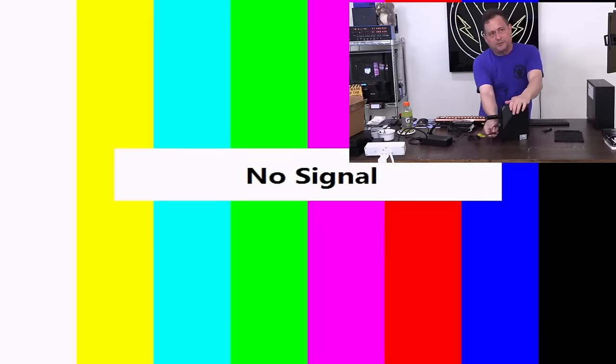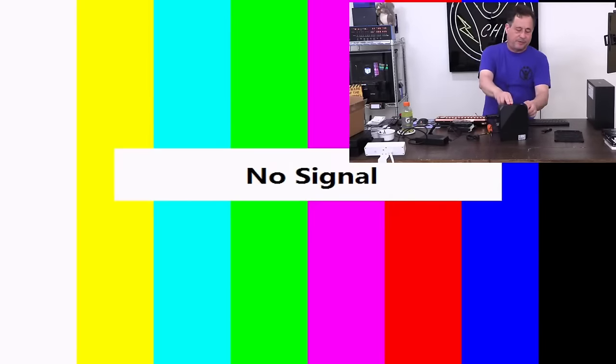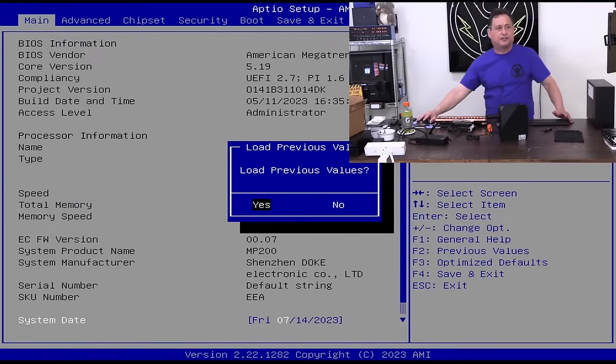What it's doing. So I'm going to unplug it. Get a few seconds. Plug it back in. Hit the power button again. And then it should sense there's an HDMI cable plugged into it and activate that port. Some systems do that only on boot up. Okay, I got lucky and we got in here.